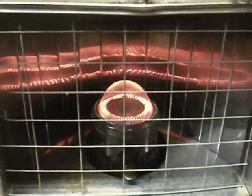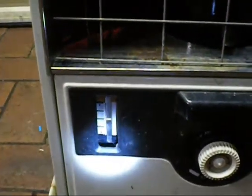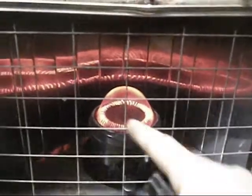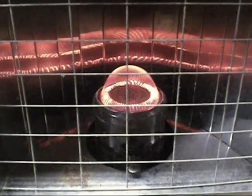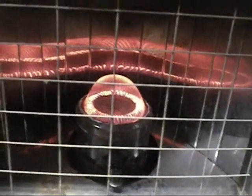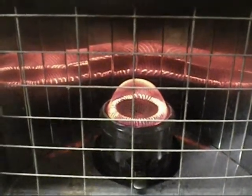That service I did to this heater seems to have done the trick because, as you see, it's running a nice blue flame, nice and hot, and we're at half a tank. Beforehand it would have just been heating up the spring, so much better. I'll still get a new wick for it soon, but there's no real need because it's working fine. With the fiberglass wicks you've got to burn them dry every now and again, just to get rid of the balls of tar and all the other crap on them, and they work nicely again.